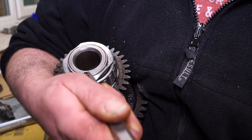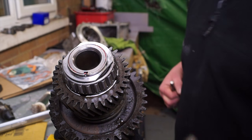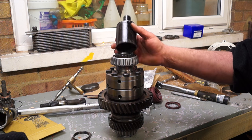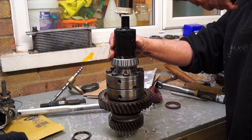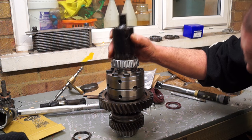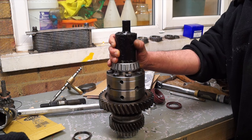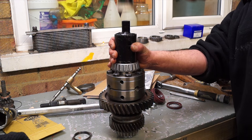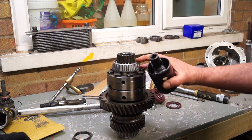We don't really need to check the gap here because we've changed nothing at all, but it is about the same. If the tolerance is out, you really need to rectify it first before you go ahead and stake this nut. We've staked the nut — this component is okay. Once it's staked, that part is finished. The bearing on the other end is obviously easy to fit. I'm using the same tube arrangement just to knock it into place, and I'm using a soft-headed hammer — this doesn't give a shock, it just gives a nice push. Bearings are on and in place. Make sure it is home firm and smooth, and we can then carry on with the bearing races.